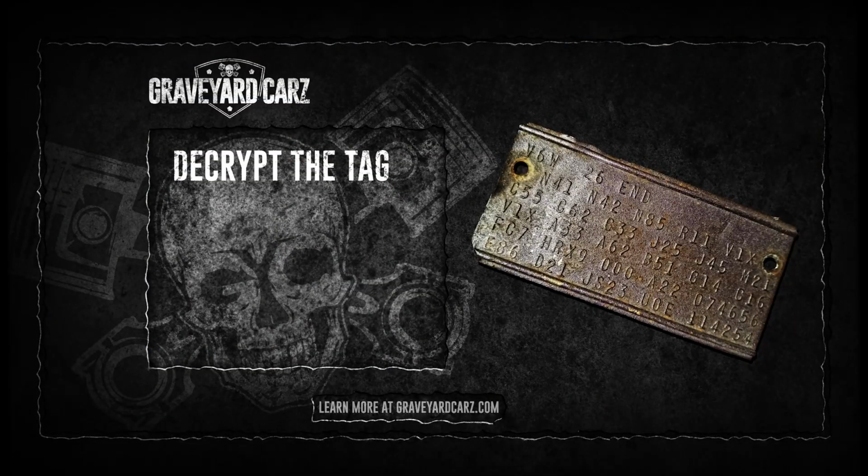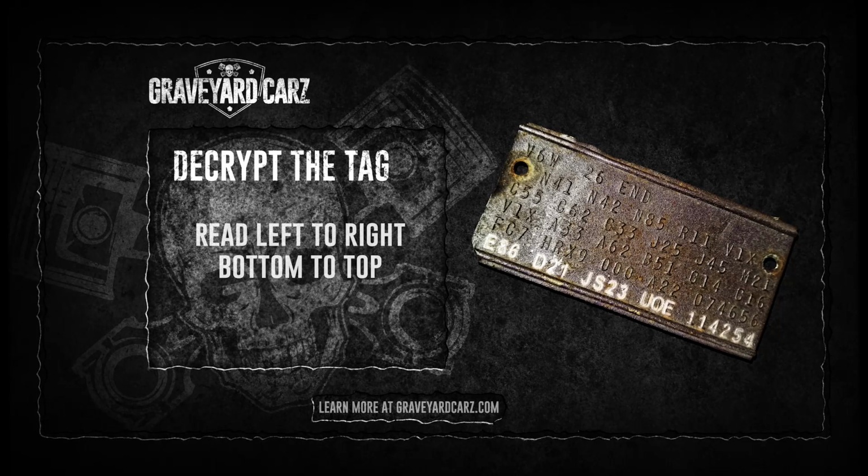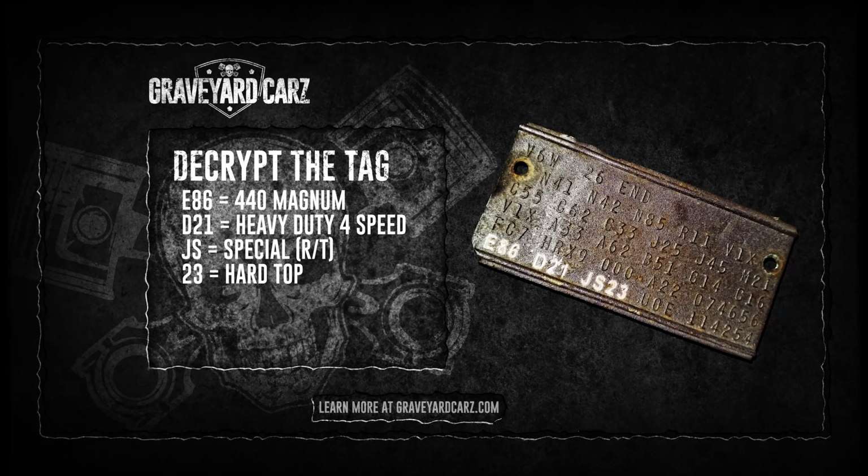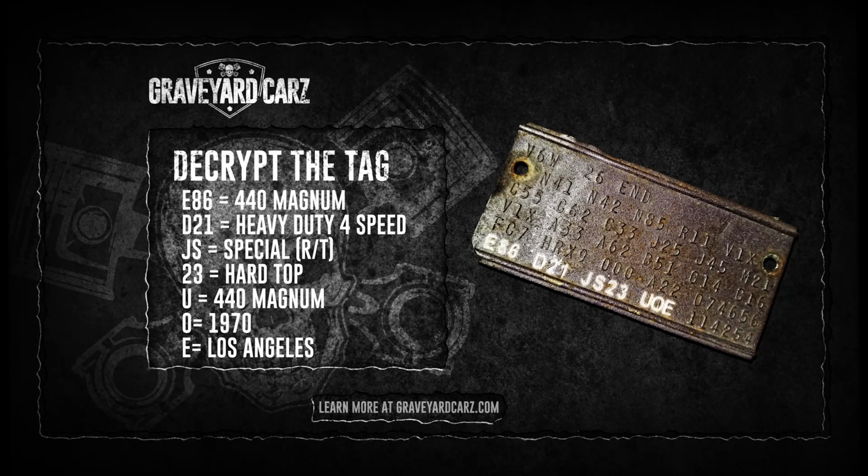Typically reading a tag, you start in the left-hand lower corner and you read to the right, and then you work your way up. The E86 means it's a 440 Magnum. The D21 means it's a heavy-duty four-speed. The JS23 represents that it's a Dodge Challenger in a special price class, meaning it's an R/T, and the 23 is a hardtop. The rest of the VIN: the U again represents the 440 Magnum, the 0 the year 1970, and E that it was built in Los Angeles.